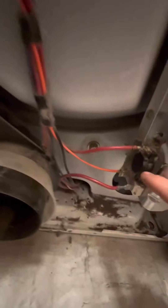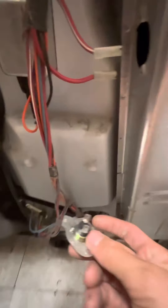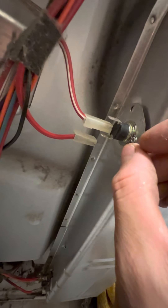You have a number of safety devices here. You have one for your heating elements here, and you have a couple down here — maybe high limit, they might sense temperature. I don't work on dryers often. This is just a light bulb in here for when you open the door so you can see. And lastly, we have this little guy — this is the high limit for your heating elements, and this is actually what was wrong. This sits right about here, just like so.